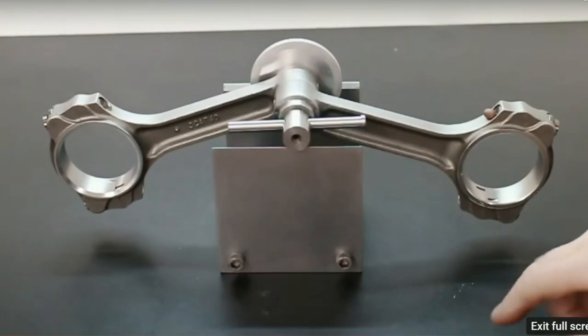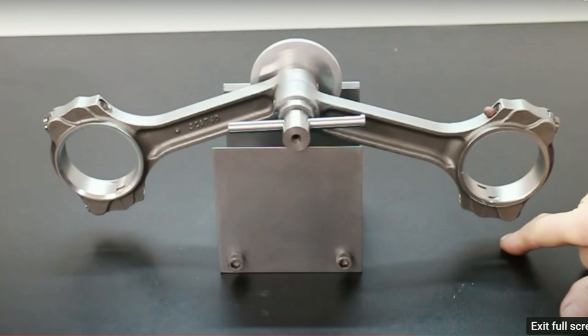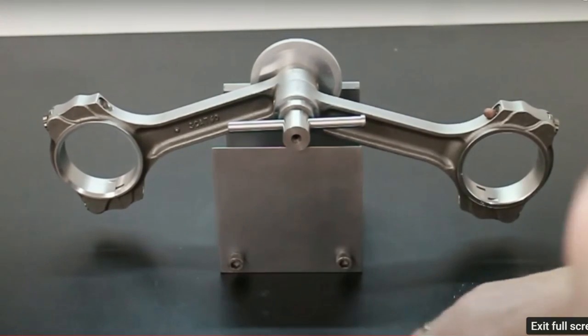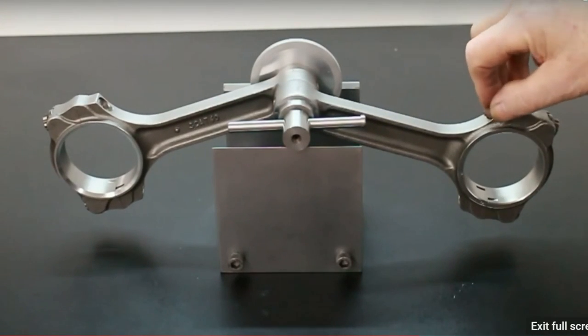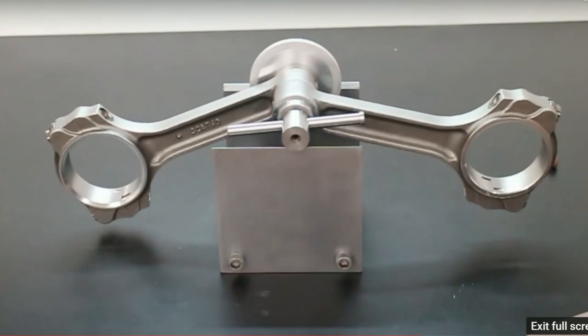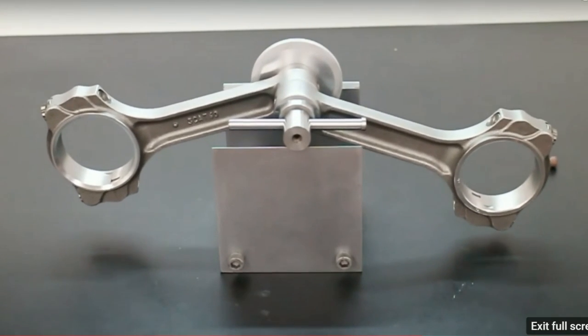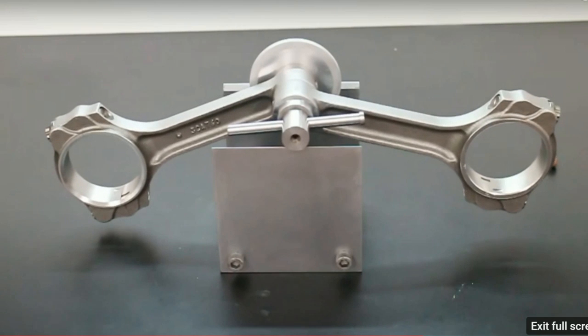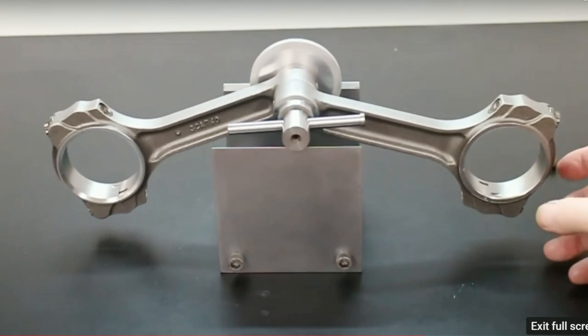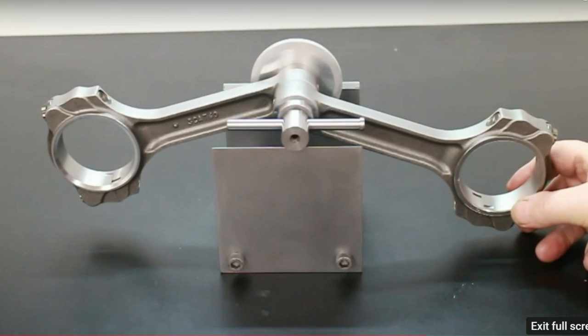Right, you can see, well, I hope you can see that this is now closer to the bench than there. So they are accurate. Doing it this way, if you're very careful, you can get both the pin end and the big end as close as 0.2 of a gram, plus or minus. So you will have some very precisely balanced rods.